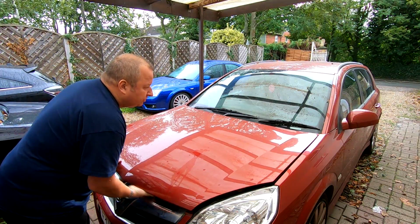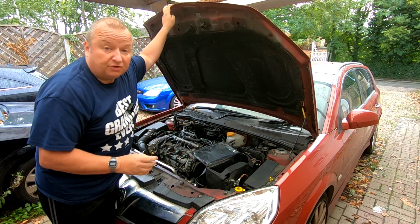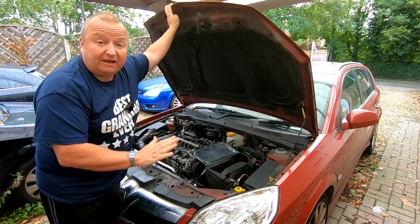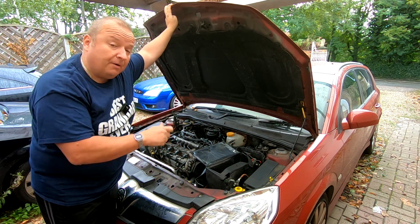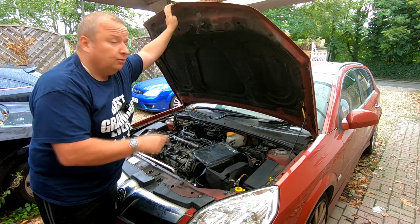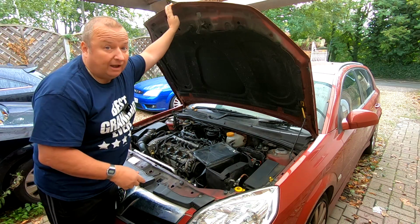Okay then, so we'll see if this Vauxhall Signum 1.9 CDTI is going to start with the swirl flap delete. The problem this car had is that it was totally lacking power. It wouldn't go above 45 miles an hour with your foot flat down to the floor. And I found out that the swirl flaps were leaking. We also had a problem with the EGR valve. Someone gave me a new manifold with that on, one of my subscribers. And I also changed the EGR valve as well. So let's have a look, put this battery on and get this thing running, hopefully.